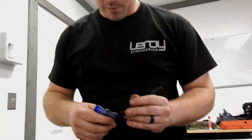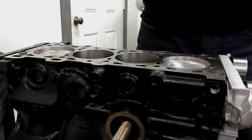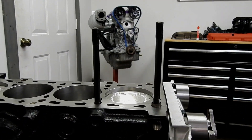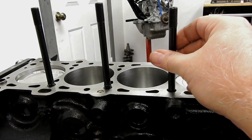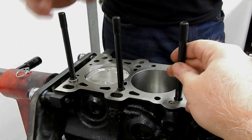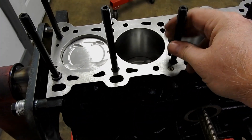We'll get all of our ARP head studs and put a little bit of lube on the bottom — just take two of them and roll them together. The good part about using head studs like this is if I ever want to take the head off, I can reuse them, as opposed to stretch bolts which I really don't like. They're also much stronger, so when I'm running boost I shouldn't get any head lifting at all.